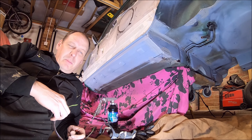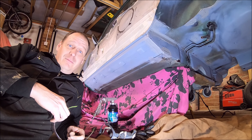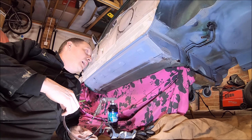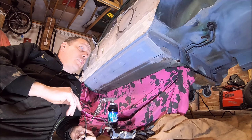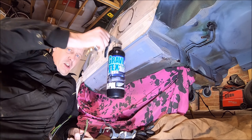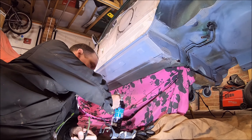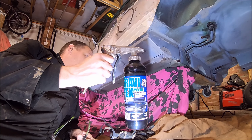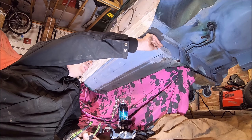We're going to do some stone chipping. This is probably one of the worst jobs — well, a job I really hate doing anyway. I've done it on Vinnie. It's just difficult doing it on the floor like this; it's alright if you've got it rolled over on a jig. It just makes a right mess as well. We're using U-Pole Gravitex. I've got the gun set at about 60 psi, which it recommends for an orange peel finish. It's a crap gun — it just spatters it on there, but it gives an alright looking finish once it's done. I hate doing it.